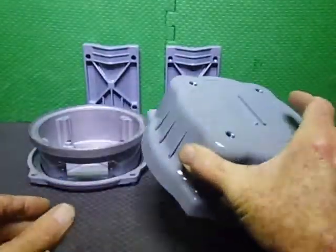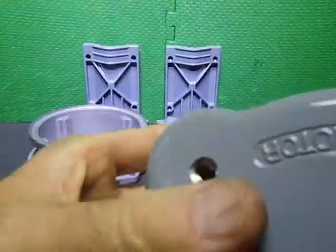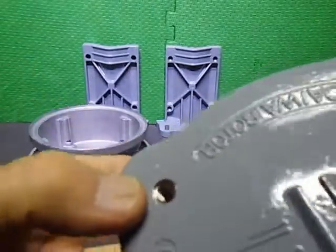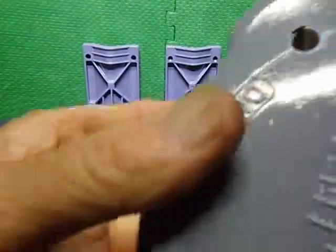The other thing I've done is I've put M8 recoil inserts into each of the mounting holes. If you don't know recoil, you drill it out and replace the thread with a stainless steel thread. These are the Australian ones.